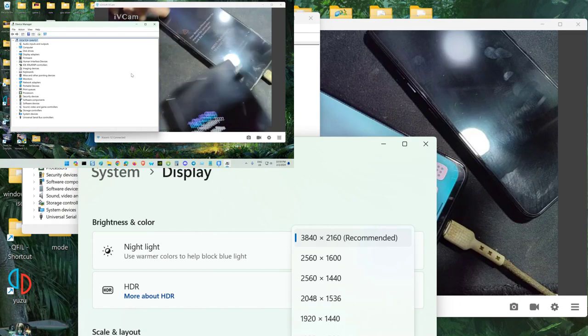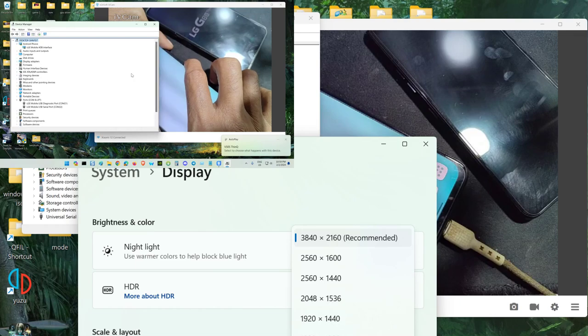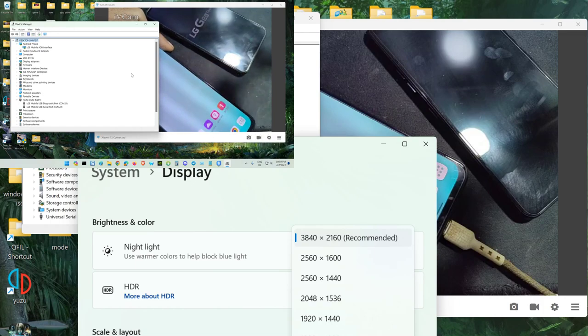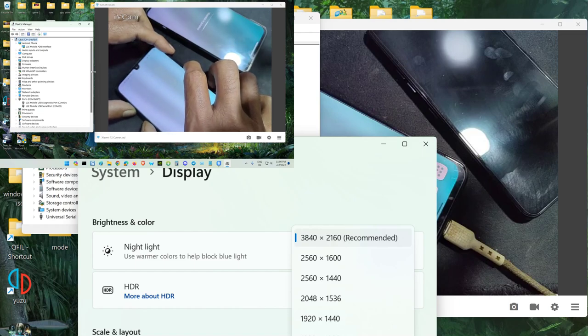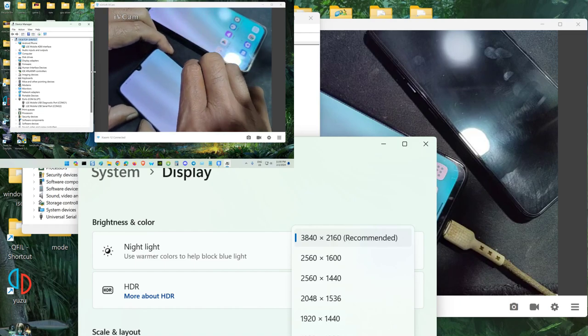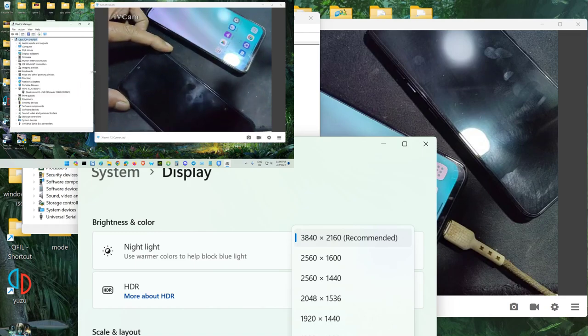And now, the V50S. I'm teaching you two methods of flashing any ROM, custom ROM or GSI ROM. The output is the same, only the style is different. Now I'm booting my V50S to EDL because I'm going to replace the stock bootloader with the engineering bootloader. Now pressing volume plus. Now the device is in EDL mode. Open your QFIL.